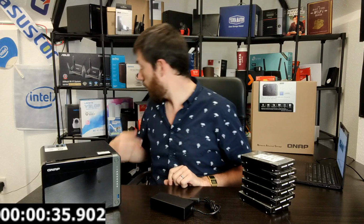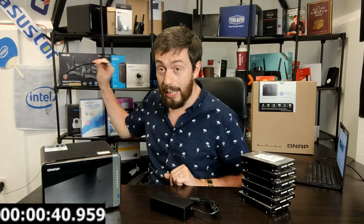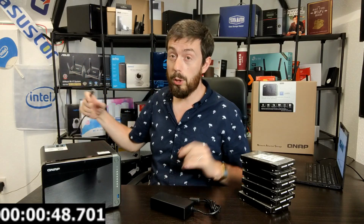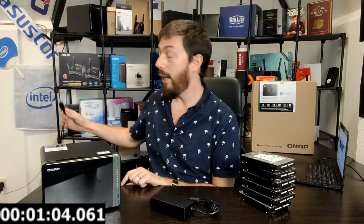Now, what you're going to need for today's video in advance is to make sure you've got a LAN cable connected to a router or switch in your home environment. That is the cable that your unit arrived with. Make sure you've got it connected to your router, the device your internet service provider gave you, or to a switch connected to that router. Make sure you've got that cable connected to that end and the other end loose. The second thing you need is a power connector. When you purchase this, there'll probably be a kettle mains power connector, and make sure you've got that ready and either connected to a wall socket but powered off, or just next to the power socket ready to be connected.